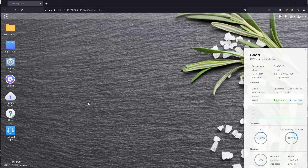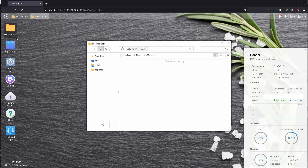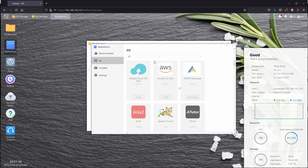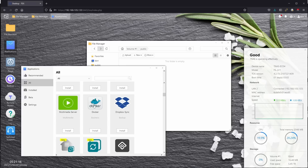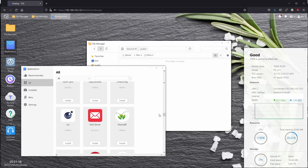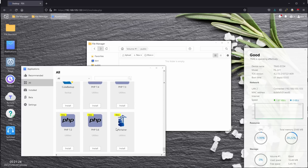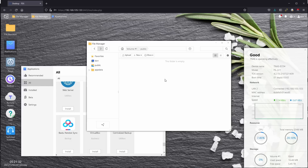The built-in operating system is TOS 4.2 — I have the latest update installed. It is similar to Synology and QNAP's desktop interface, where you can navigate and run applications like file managers, Docker, and virtual machines. On first boot you can see it's already using almost 1GB of RAM just powering on, so upgrade the RAM if you plan to push it further. You can install Docker, Portainer, or even a virtual machine like VirtualBox, making this a pretty good mini server on top of the NAS.